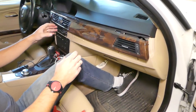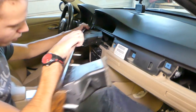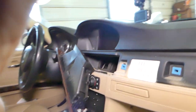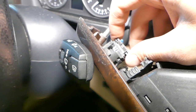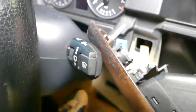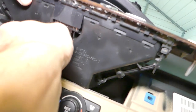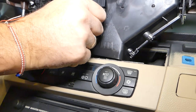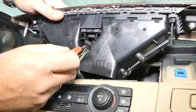It came out. Now right here in the middle you have two wires that you'll need to disconnect. First, disconnect the ignition switch wire — the one right here. Press down and pull it out. Then we have wires underneath; we need to flip it the other way. With a small flatdriver we gently pry this wire out — it has one tooth holding it in place. Then there's one more wire to disconnect.